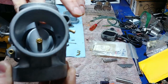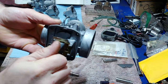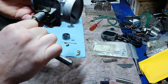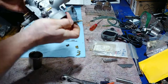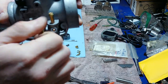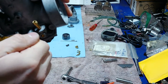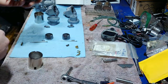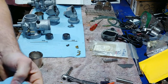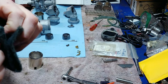You just want to stick your finger in there to hold it. Then you've got the little pilot screw — I like to put a tiny bit of grease on the threads of these so they spin a lot easier. They can get so corroded that you've got to get in there with pliers. You're better off just taking the whole carburetor off and cleaning it — you can even run a little tap through there to clean up the threads real good.